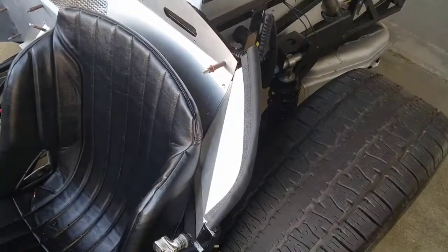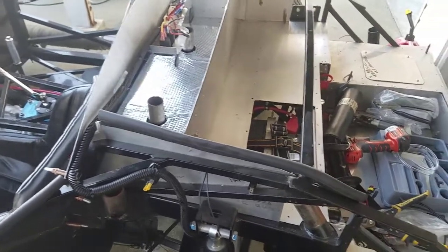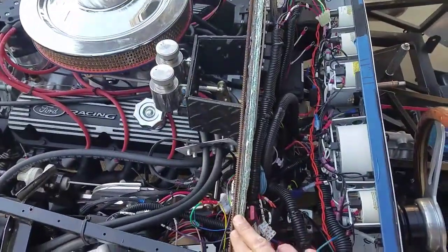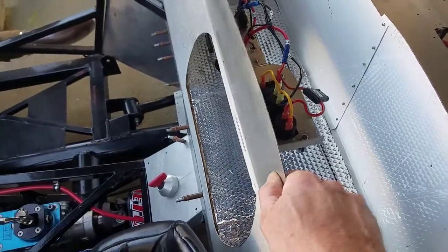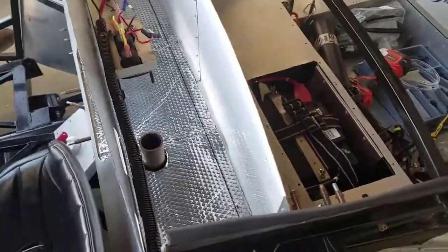Alright, well, let's see, the back aluminum is getting in place. A bulb seal here because I'd like to put on the body. I really don't know what I'm doing here. I'm just kind of putting the bulb seal on the trunk sides. They said, they being the book, said that this doesn't get bulb seal. The firewall does get bulb seal, but for my fitting, the fitting is more for the back drop butt mod, so I'm not too worried about the front right now. What I am worried about is this waviness here. Now I know that it's not riveted or fastened against the steel, but you can see that there's a waviness here, so I'm going to try to maybe leave it open right now and see if that waviness goes away.